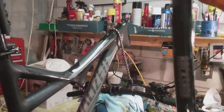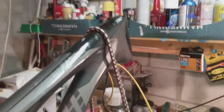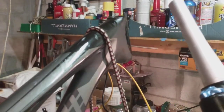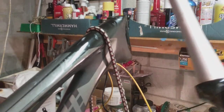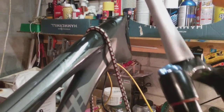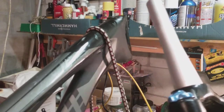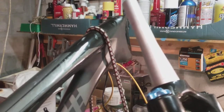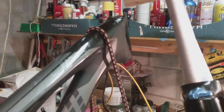Taking my front suspension fork off — it's a RockShox — and it turned out to be a little challenging. I've replaced these head bearings before, but I just wanted to give some folks some tips I ran into. There's a bottom bearing and a top one with this sleeve. This aluminum sleeve was jammed down into the bearing, so it was very difficult to get off. What I had to do was tap the top of this to get it out of the tube, gently, using a wooden block so I don't damage anything.